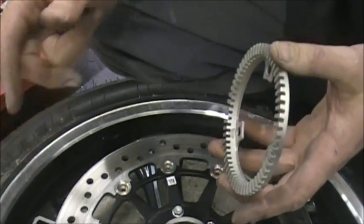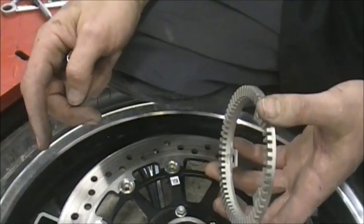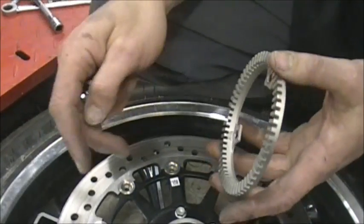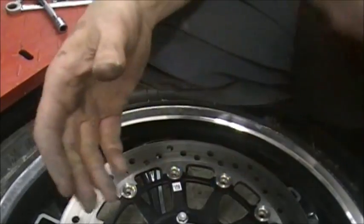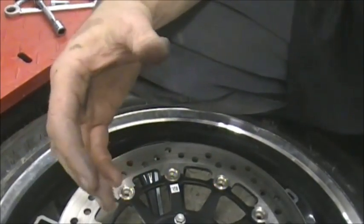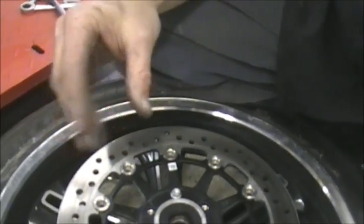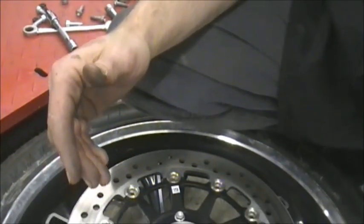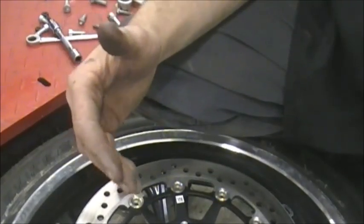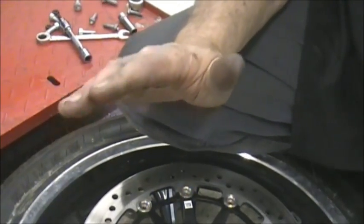So when you hit the brakes really quick, it figures out that in a certain distance for the speed you're going, you're slowing down way too fast, so it turns the anti-lock brakes on. What they do is pulse on and off a whole bunch of times in a second to hold your brakes. That's why, if you're in a car on ice and you hit your brakes, you feel your brake pedal vibrating. That's what it's doing. The anti-lock brakes are working.